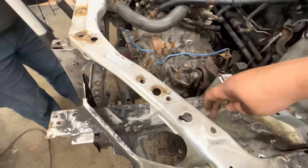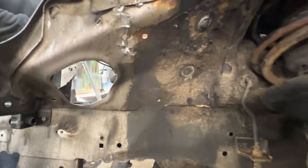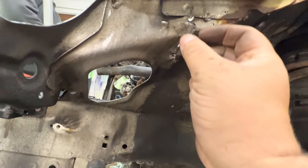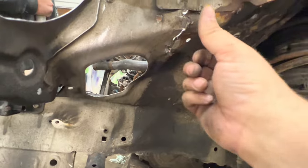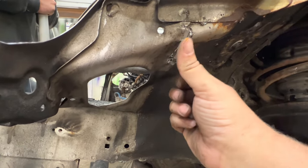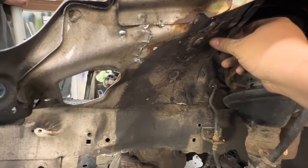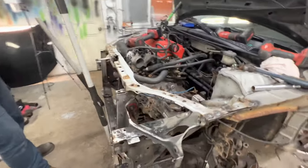For anyone thinking this is just body metal — you're literally burning through it quite easily. You can see those are penetrations, so we know we got good penetration. That tear is from the old mount. What I plan on doing is grinding that up and putting a piece of metal here, welding it from the top as a backing plate so I don't have to try to weld up the torn metal — it'll just burn away. I want good penetration, so I'll clean that up, put a piece of body metal there, then re-bedline in here so it looks factory. No one will know the difference — other than if you watch this YouTube channel.